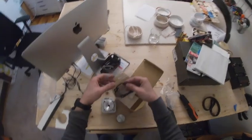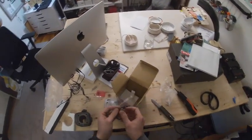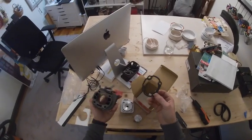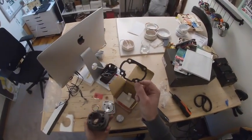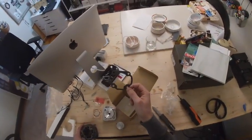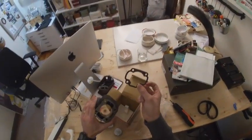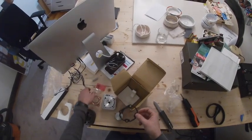In this packet you're going to have your base gasket, a head gasket, and a set of rings. This is your base gasket — that goes on just like that, we'll put that on tomorrow. The old one may be good and stuck to the block of the motor. Basically if it's on there really nice and none of it has come off your old cylinder, they're the same size so you can reuse it — though I don't really recommend it. It's a pain to scrape off but we'll make that call tomorrow.